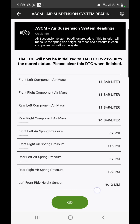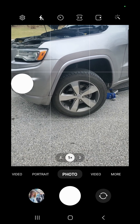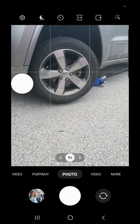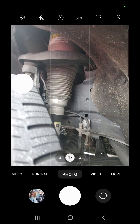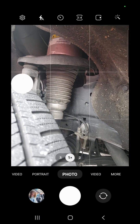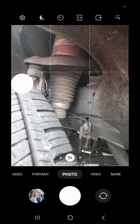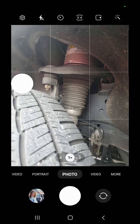We're going to record that, and then what we're going to do is jack the car up and let it sit there for a bit to see whether it sags. The car is jacked up now, wheels off the ground — you can see the actual strut itself. It's an original, and I do suspect it's leaking. By jacking up this way, if there are any holes in the bag that are covered by the folds when it compresses down to a lower height, they'll be exposed. At about 80–90 psi, it should significantly leak out, so we'll see what happens when we come back in 30 minutes.